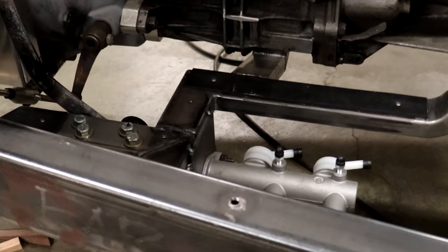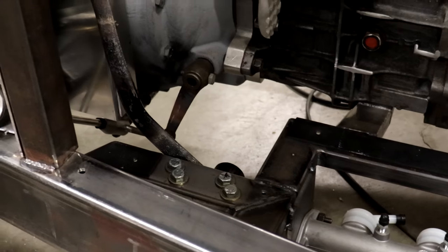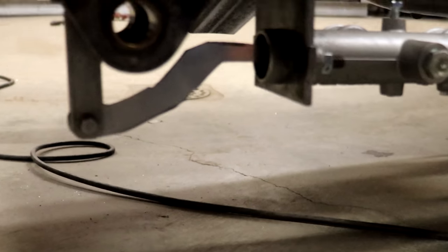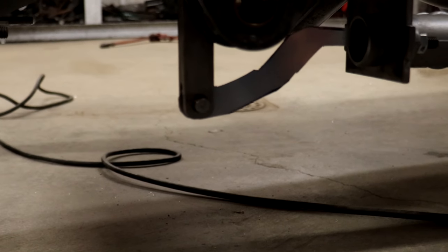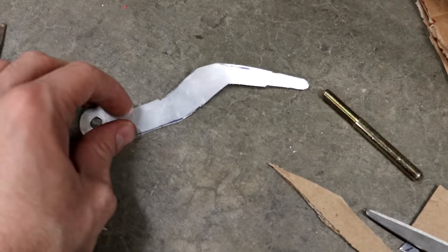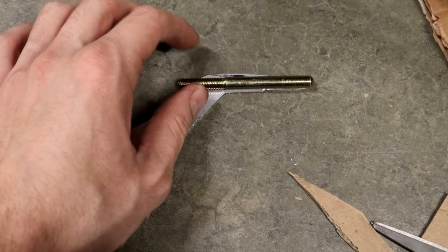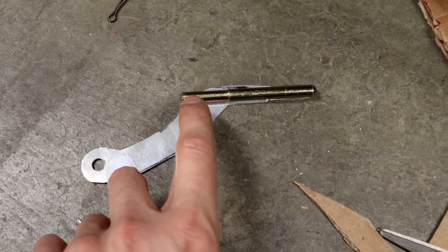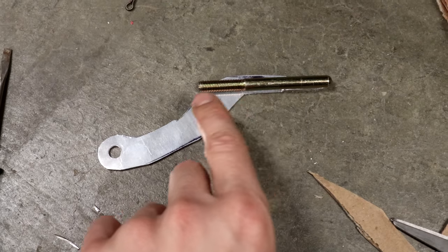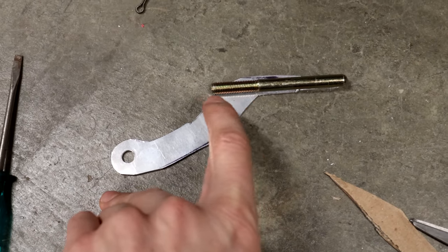So there is the brake pedal in here now with the master cylinder bolted into its bracket — that's just sort of tacked into the subframe there. I have it connected right now; it's kind of hard to see but you can see that mocked-up linkage there connecting the brake pedal to the master cylinder. All that is right now is a piece of aluminum I made to mock up the shape that bracket is going to need to be, so I can make it out of a much more sturdy piece of steel. This is the original push rod that came with the master cylinder and I'll probably incorporate this into the bracket — maybe a steel bracket threaded into this piece so it's still adjustable if I want to adjust the brake pedal. I just need to make this little bracket with a couple nuts on top to hold that in.